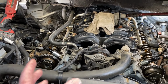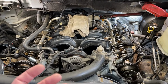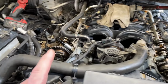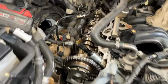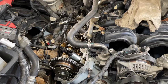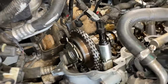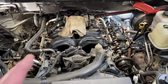is the reason why we're having that rolling idle on all cylinders and just runs rough in general, hot idle, all because these cams are incorrect for the vehicle? So they look right, okay? Just look down, they look right. They're definitely on the right side because one actually sticks out further than the other one. So you can't mix it up. And you can see they're lined up going down to the guides and all that stuff. So they're on the right side, but are they the right profile?